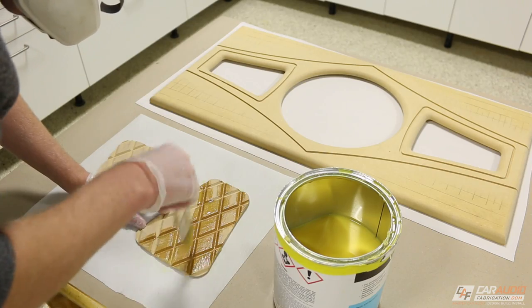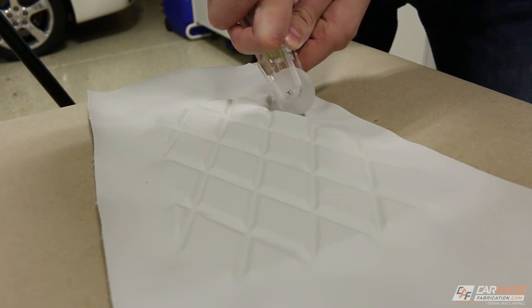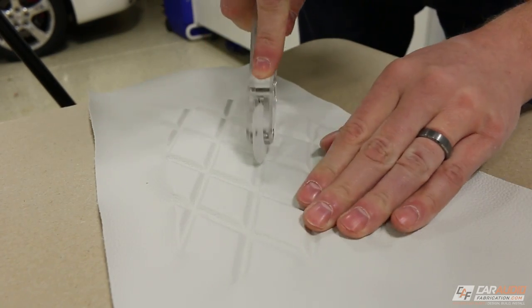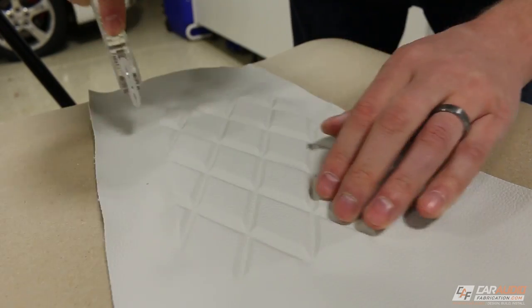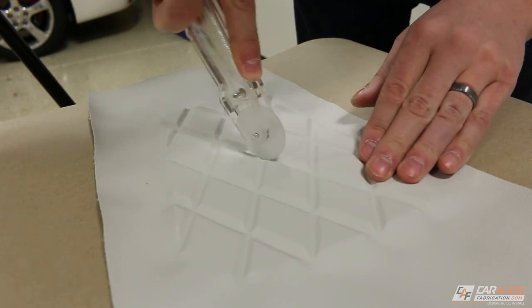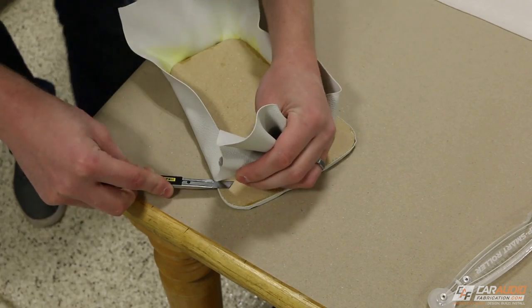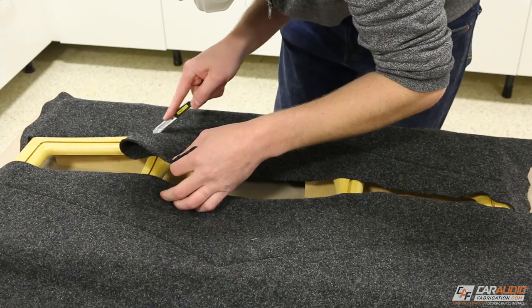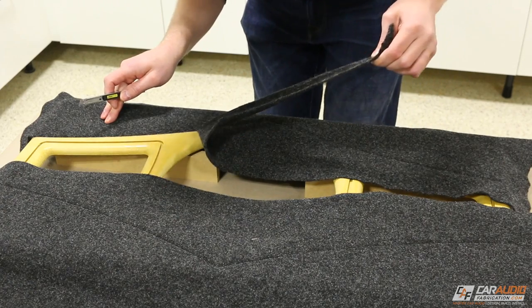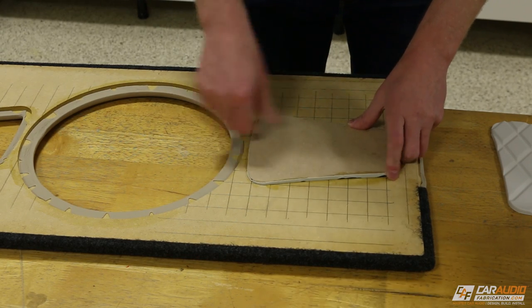For the sake of time, we're going to fly through the upholstery process — if you want to see more detail, you can check out some of the other videos on my channel. For wrapping the piece that has the diamond pattern on it, I want to make sure that I use a roller tool to push the vinyl down into those grooves before I wrap it around the outside perimeter. This tool is much more solid, which really allows me to push down and put some pressure into these grooves, and the wheel is much wider, allowing it to better match those grooves. I'm carefully cutting away the excess material from the back. I'm also using the roller to push the carpet down into this transition — I'll use that line to allow me to precisely cut the edge of the material. Once I've also added the vinyl to the front of the project and wrapped it around the back side, I push my inserts into position.